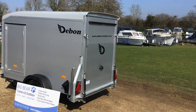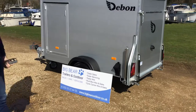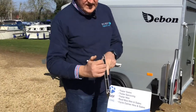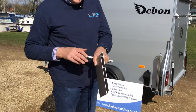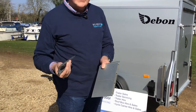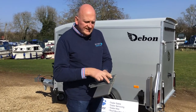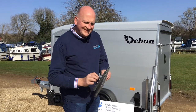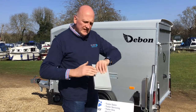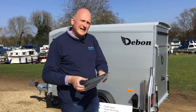Here's a sample of the aluminium planking — it's basically a double skin with inner and outer skin and structural reinforcements in the middle. What we do quite a lot of is the cargo rails: we fix those in top and bottom every other one all the way along, piercing the inner skin and going into the cavity, so you get all the looks of the trailer on the outside but lots of practicality on the inside.